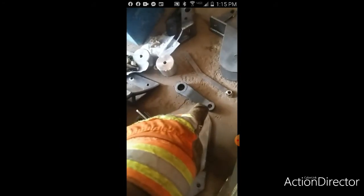So this is the kit that converts all that over, so that everything's done right. You have new coil buckets. You've got the new traction bar arm, which I like to call a panhard bar mount. And you've got new radius brackets that will take this older truck over to the newer style, that hold the back of the radius arms. And the new pitman arm from the older gearbox to the newer inner tie rod end that goes for the newer 07. Also the brackets for the sway bar, which I have yet to buy, and all the tie rod ends and other suspension parts that I will have to buy. And there's also an alignment piece that goes on the inside of the frame.